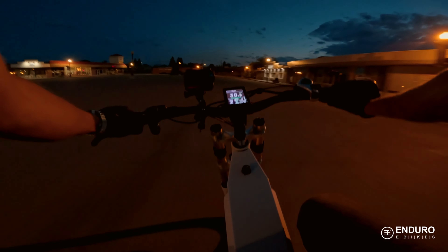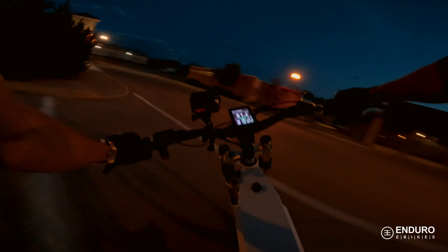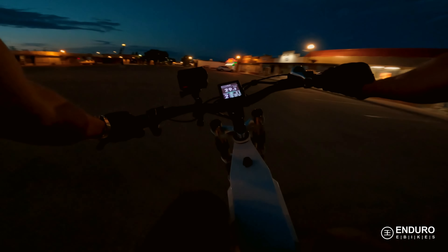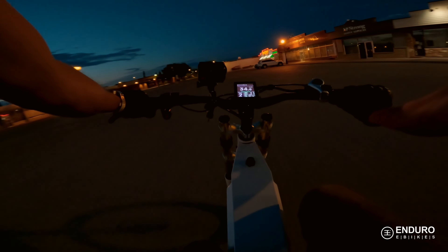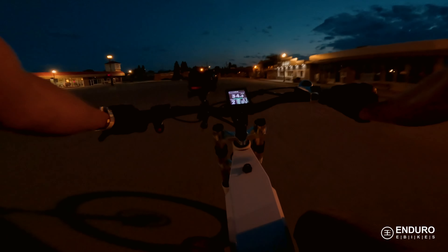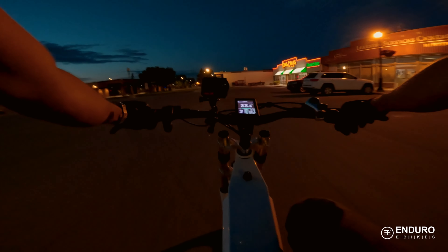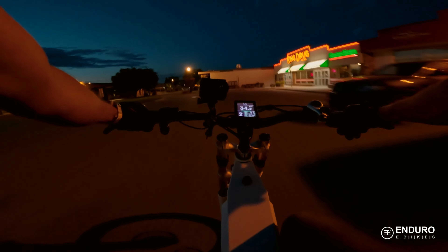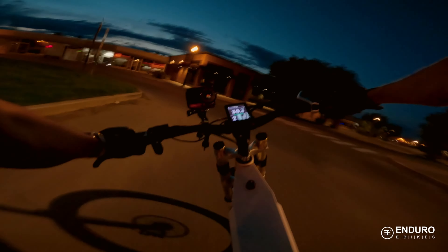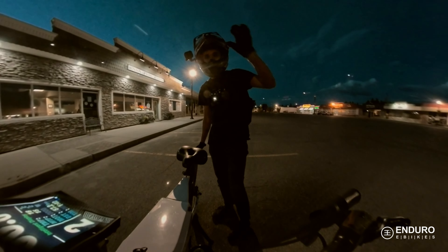This is crazy how long this battery is lasting. It's only a 22.4 amp-hour battery — I'd say that can be attributed to the small motor size and the low amperage controller; it's only a 40 amp controller on this base model bike. That helps get us the kind of range you're seeing here: 56.4 kilometers and it's still going. Oh — there it goes, the BMS just cut off the battery power. Battery is flashing.